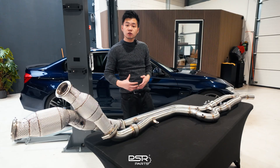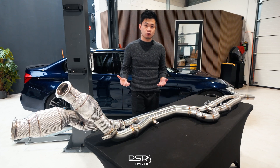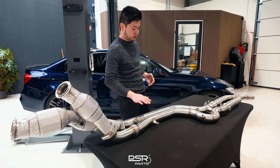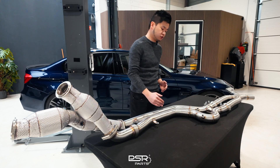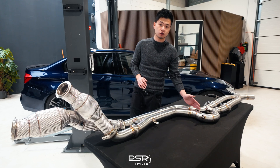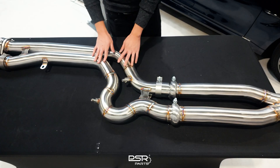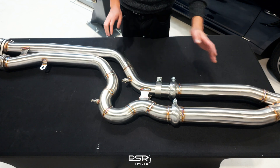Exhaust flow bounces between corners — it does not follow the center line. So why make the pipe with bends actually longer than the other side? That comes down to flow dynamics. Even though that pipe is a little bit longer, when they mix at the junction under exhaust pressure, the actual length traveled is the same. Exhaust gases bounce in the curves, and once pressure builds up the flow finds the shortest path. We had to make the left pipe slightly longer to ensure that under pressure the exhaust flows meet at the same time. Here you can see from above: one side compensates for the shorter downpipe, and the other side is actually a little longer.